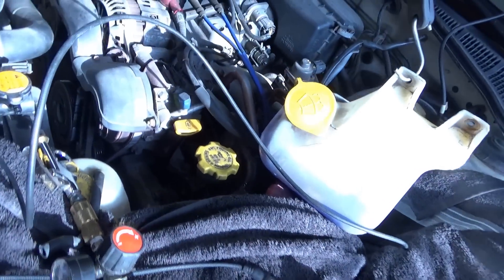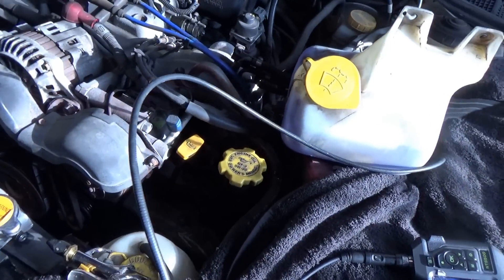What do we do? The head gaskets are multi-layer steel. Doing another head gasket job on this car — it's got a rusty gas tank, and the customer obviously doesn't want to invest too much money into it considering it's an old beater. Can we try torquing down the head gasket bolts? I know this is not standard practice and I might get ripped apart for this, but there's nothing to lose. If we torque them down and the coolant leak stops, she can get another few years out of it — that would be a win.